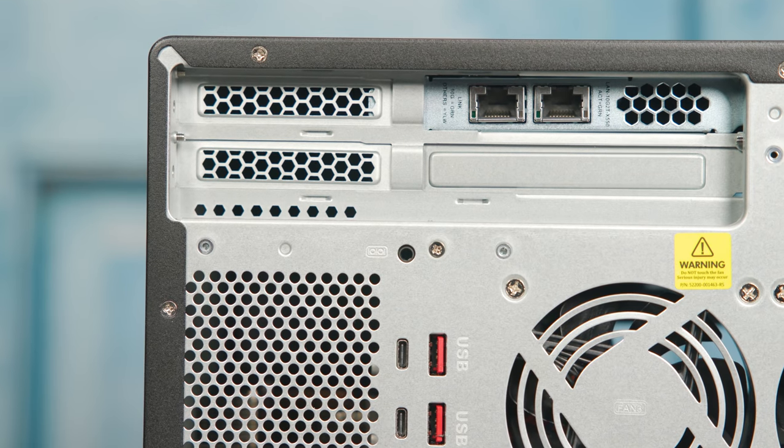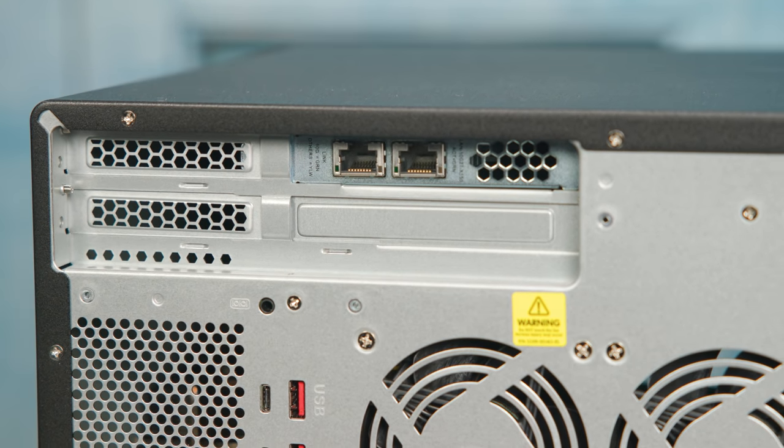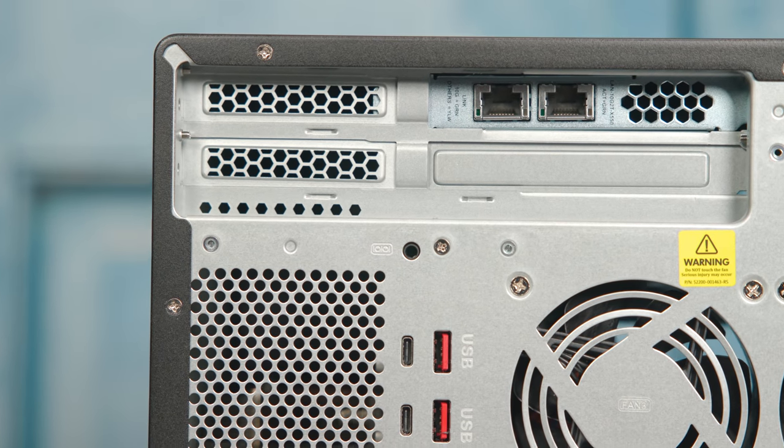But the networking doesn't just stop with the two-and-a-half-gig ethernet ports. There are also two 10GBase-T ports — 10-gig ethernet — on a PCIe card in a dedicated slot. One of the biggest challenges whenever we review 10-gig ethernet is that half the people wish it was SFP+, and the other half prefer 10GBase-T because they already have CAT6 or CAT5E cabling and don't want to deal with optics costs. 10GBase-T is usually the more expensive option but uses less expensive wiring, and that's what this one has. Next to the 10GBase-T card there are also two extra slots, which we'll get to in a bit because they're super exciting.